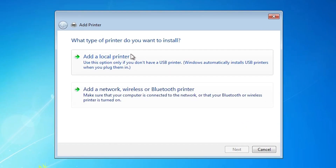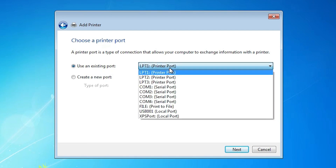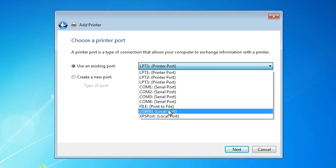Minimize this window. Here we find 'Add a local printer'. Since this is a USB printer, select 'Add a local printer'. The most important part is the port. Select here, and if you find 'DOT4_001 HP printer device' then select that. If you don't find it, don't worry — just select any USB port such as USB001, USB002, USB003, or USB004, then click Next.